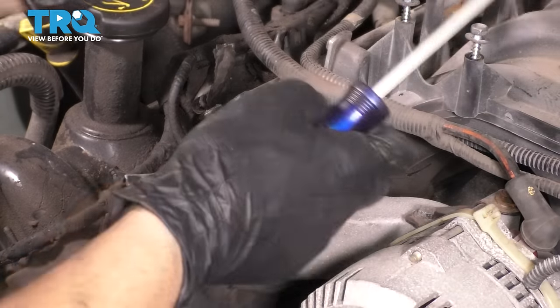Okay, I'm gonna put in some of these head bolts here. I'm gonna pull this wiring harness over this way. This should give me a little bit more space here. I'm gonna put in the rest of these head bolts. And obviously, just like on the other side, thread them on by hand so that they start in properly. Cut that wire tie off of this tricky head bolt. Start that one in. 30 foot-pounds, here we go.